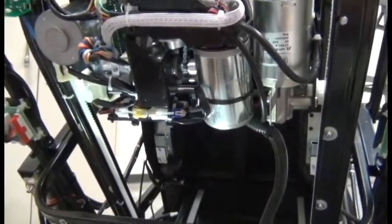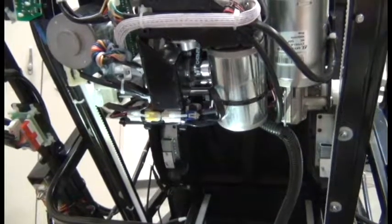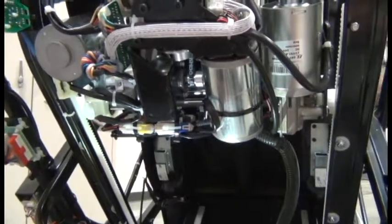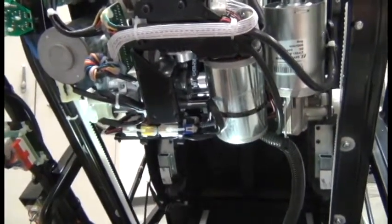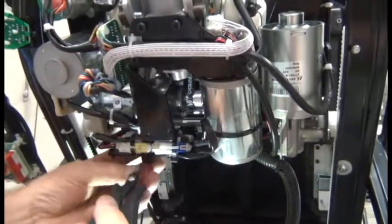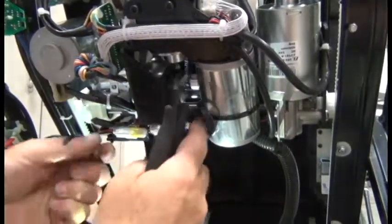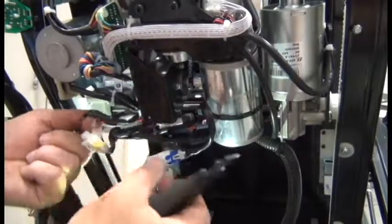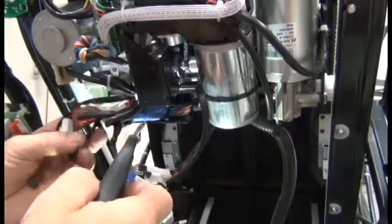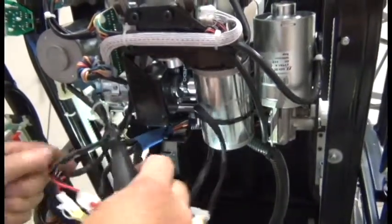Next, we're going to begin disconnecting the various connectors. But before we get started, it's really important to take a picture or something, because you'll need to have very careful reference when installing the new mechanism. These connectors and zip ties need to be replaced exactly where they are now. So we'll cut the 2 main zip ties that secure the connector bank, which frees up, looks like 4 sets of connectors, which we can then continue cutting zip ties to free those connectors.